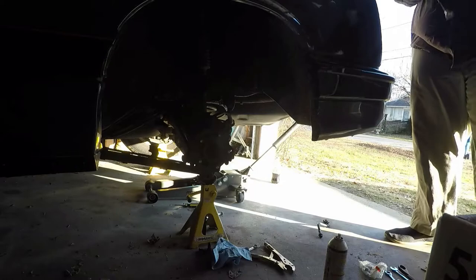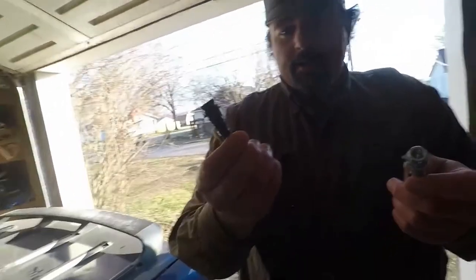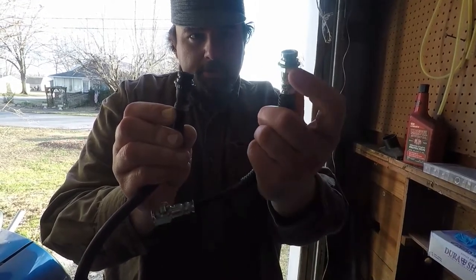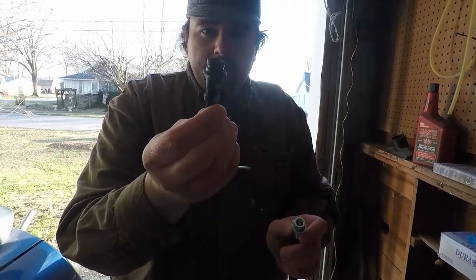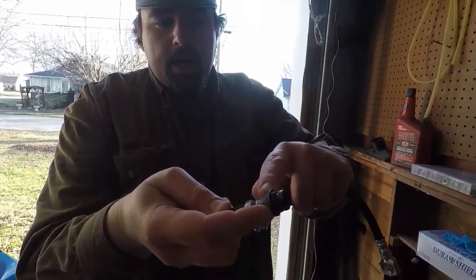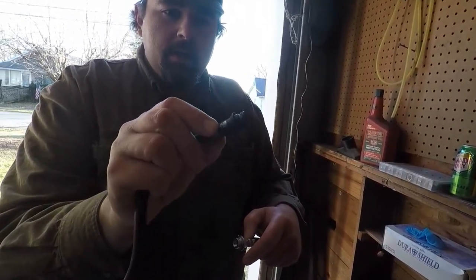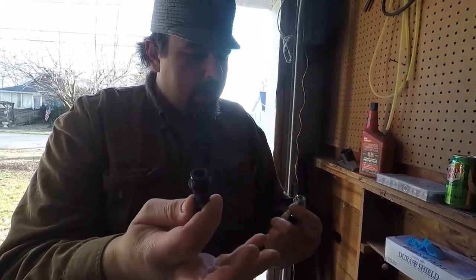Let's see if I can make this. Now, see, this one has what this is supposed to have. Camera, come here. As I said, instead of having that like it's supposed to, where you can cut the hose and put a socket on it, it has a round thing with two flat ends. And those flat ends don't have enough purchase. You see, I got a wrench on it and it chewed it off because it had almost no end to it. So they probably have a special tool for these, or did in the 90s.